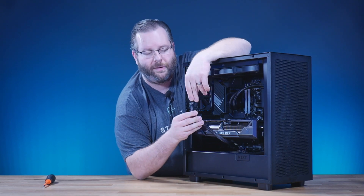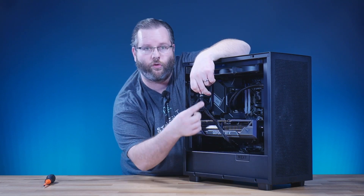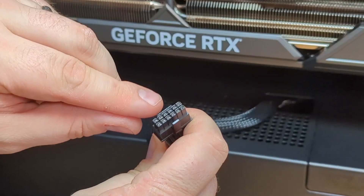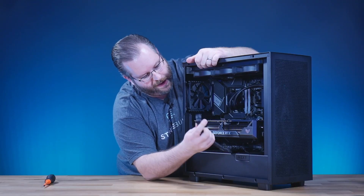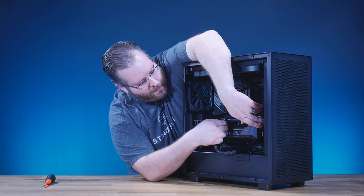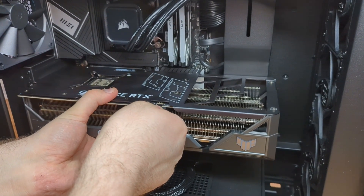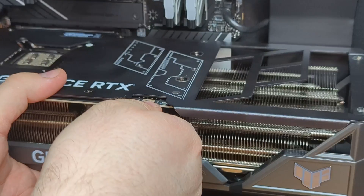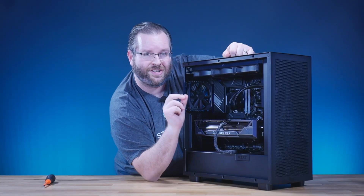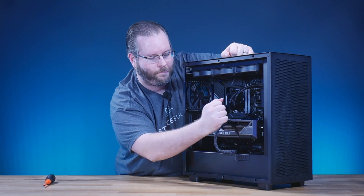A lot of these systems are going to come either with an ATX 3.0 power supply or with a one, two, three, or four pin adapter. What we have today is a single 12-volt high power cable, which is a standard cable only found on ATX 3.0 power supplies. We're going to take our cable and properly seat it in the graphics card. Grab the card gently and push this cable in completely — make sure it's completely against the card with no cables pushed or tugged to the side.